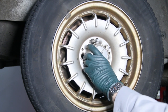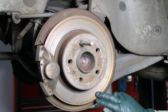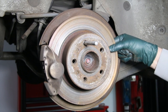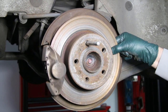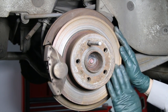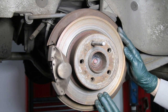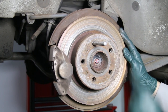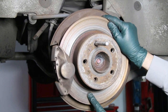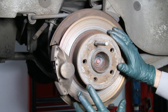I'm going to pull the wheel now and let's look behind and see what we find. Just take a look at this rotor — I have never seen anything this bad. We're talking about possibly a quarter inch of metal. If I put my fingers in and squeeze here, that rotor right in this location is only about an eighth of an inch thick. Over time — and this had to happen over a couple of years — the owner drove this car and the metal kept wearing off the rotor and getting embedded on this alloy wheel. That's what was causing the rust. I'm almost convinced this right here is what was causing that clunking and grinding noise at low speed.